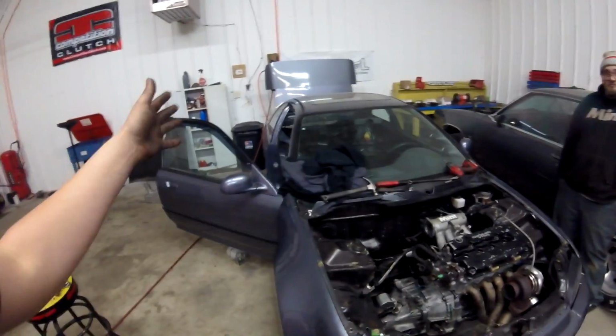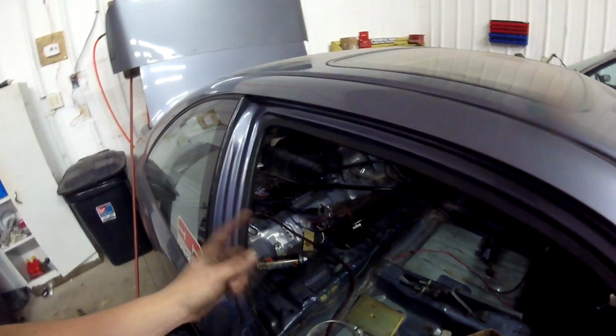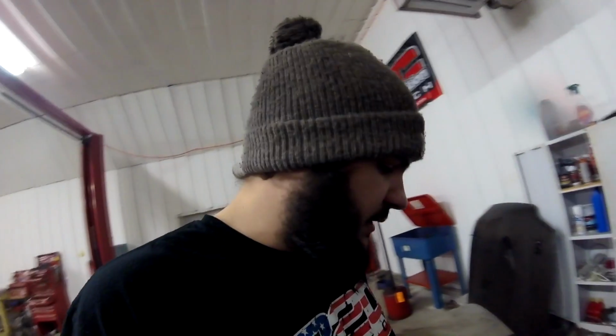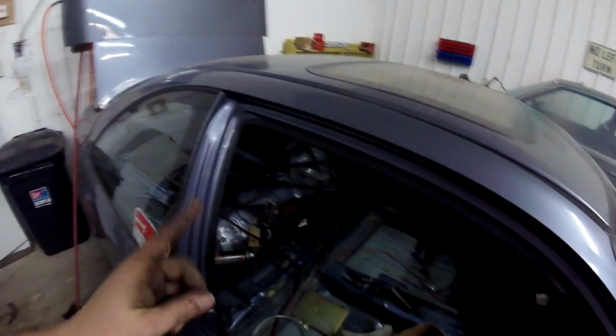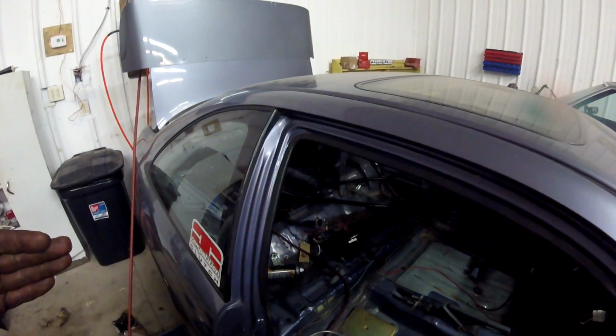I really just have to move it out of the back here, and I have to install my new fuel pump. This thing has a full-blown dual pump hanger with -8 feed, -6 return. I'm going to be running that, but I'm not going to be running two pumps. I'm just going to run one Walbro 500, or the 525. It's the new high perf Hellcat Walbro fuel pump, and I think those are good for like 700 wheel on ethanol. I'm not 100% sure, I could be wrong, but the big fuel lines and the top hat for the tank help a lot.